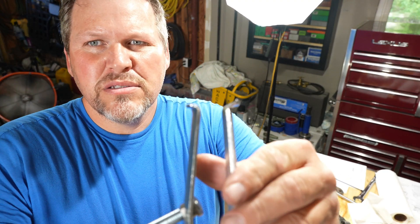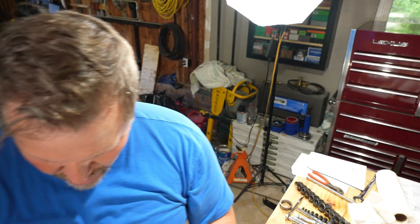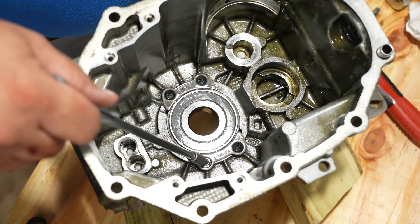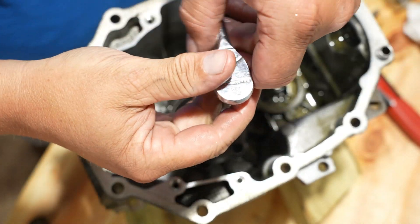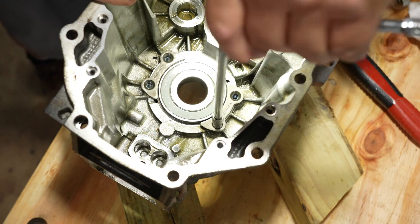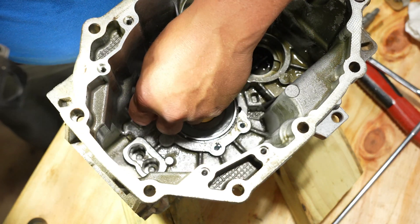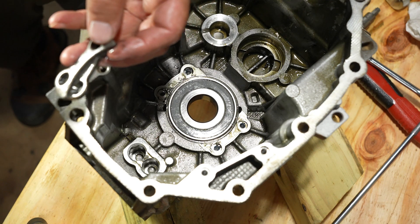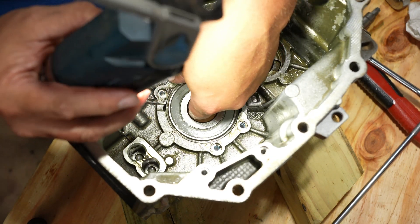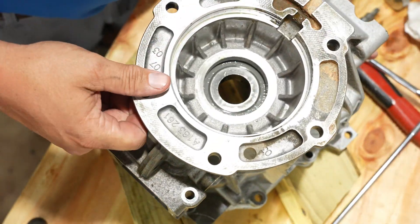Let me show you the puller — we did bend the ears over a little bit, but that's fine. It'll still work great for seals. This is the last Torx here in the rear transmission case and they all have Loctite on them. Mark these — rear transmission housing bearing retainer. I need to flip that around and knock it out. I have one I need to watch out for.